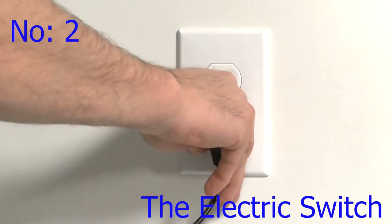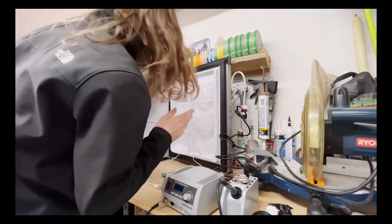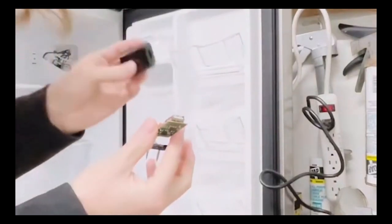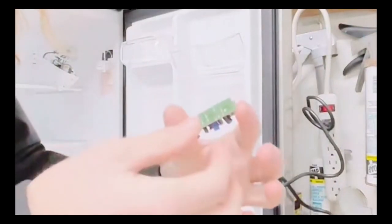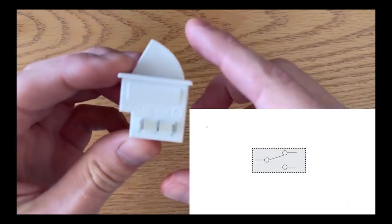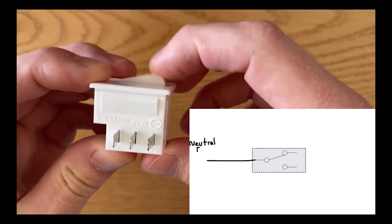Number 2: The Electric Switch. The switch is set inside the fridge and can be seen after opening the door, and starts working after closing the door. The red button in the middle of the temperature dial is a switch indicating electricity in the line. Disconnect the power for safety before starting any repair work. Sometimes the door switch not only controls the light inside the fridge but also the fan. Two wires are connected to the switch to control the light.